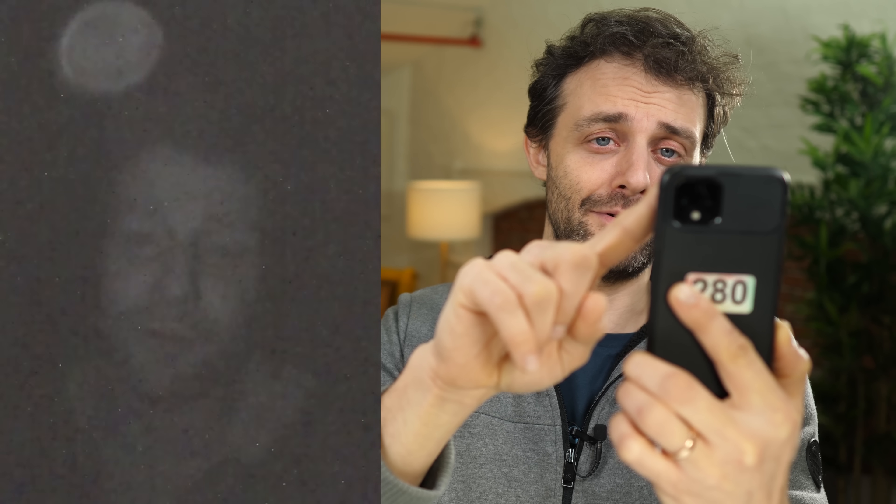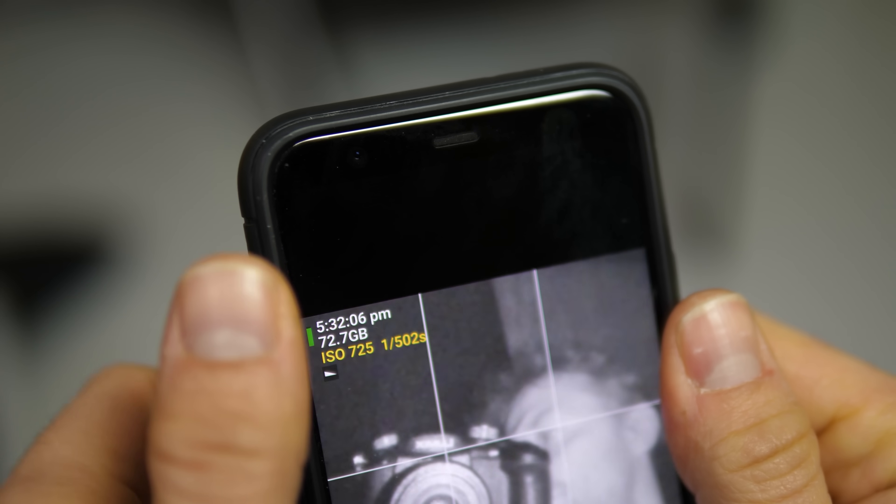By playing around, you can get a sense of how the face unlock works. Like if I put my finger here, I'm sort of casting a shadow on my face. And if I bring it all the way over to that corner of the phone, I'm blacking out my face completely. So the infrared torch is in that corner of the phone. And if I put my finger over this corner of the phone, I'm covering up the infrared camera itself. So the infrared torch and the infrared camera are on opposite sides of the phone. And that makes sense, because if the torch and the camera were in the same place, you wouldn't get any 3D information if they were exactly on top of each other, because you would just get a uniform grid of dots no matter how I move my face around. So by separating the two out, you can extract this 3D information, and they're separated as far as possible on opposite sides of the phone.